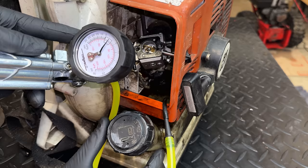Nope. I've got to say, this one has me stumped. At this point, I have pretty much eliminated everything as the problem, yet the problem still exists. I just double-checked my work as far as the tank vent goes. There's no issue there. I tested the line to make sure it could build pressure and hold a vacuum, and that passed as well.